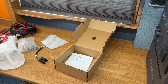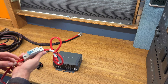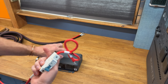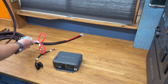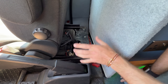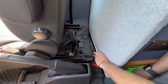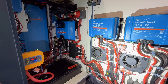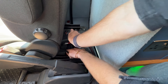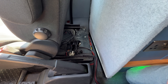Let's get it installed. One observation is that the breaker is going directly into the charger and the charger will be mounted at the back. Best case scenario, you should actually have your fuse or breaker nearer the source — the battery — and not five meters away. The cable is very flexible. In a Ford Transit, your starter battery is actually in the driver's seat area, so you've got access to the negative there. This comes off my customer connection point, which runs my traditional DC-DC chargers at the minute. That is less than three minutes to install.